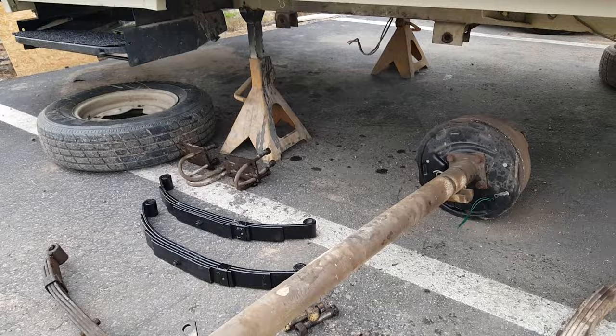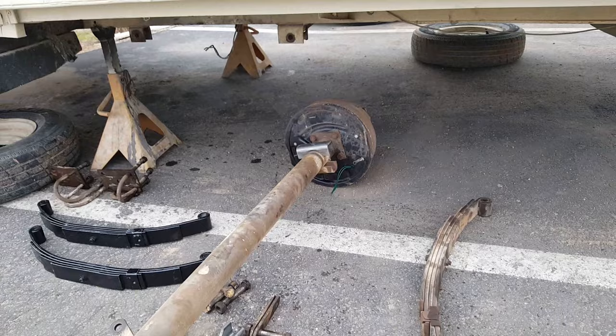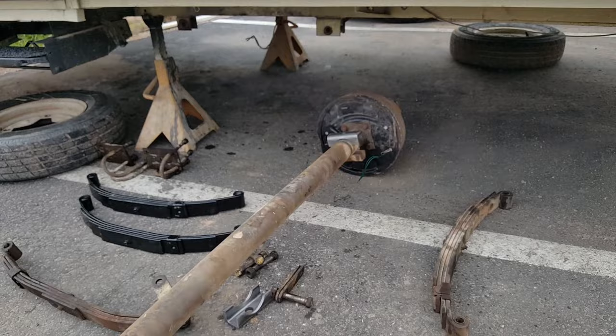So this was an awful lot of extra work. And these are newer brake pads - you can definitely tell that these are newer. So I have to weld on those two new perches, flip the brakes, put everything back together, then put it back into place. If you ever flip an axle, you've got to weld those perches on - they're actually really inexpensive.